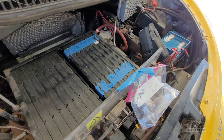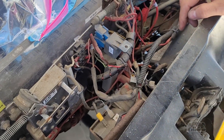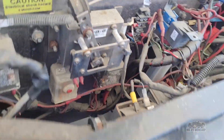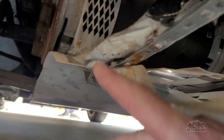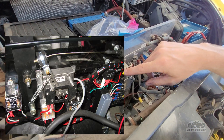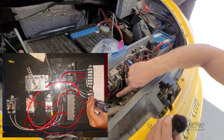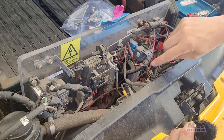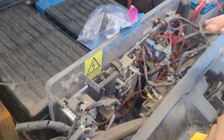You've got batteries, a speed controller, and a DC motor — you can actually see it from below. There's a potentiometer from Curtis Controller — they call it a pot box — which is a rheostat. Nowadays you want to use a Hall-effect sensor. There's a bunch of relays; this is the DC-to-DC converter relay. If this gets lower than 8 volts, it'll open up all the relays, and you can actually click it on by push button.